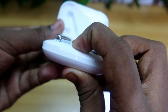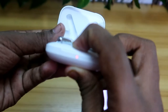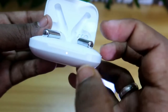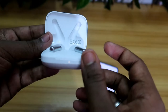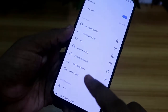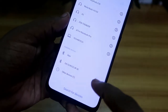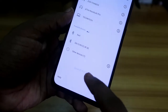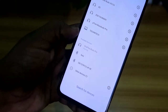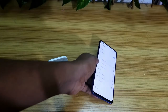Continuously press and hold the button. You will see the red color light blink, and after that it blinks white — that means the earbuds have been reset and have gone back into pairing mode. Now go to your Bluetooth settings, unpair if already paired, search for devices again, and the OnePlus Buds Pro will be listed. Click on it and it will connect in a moment.